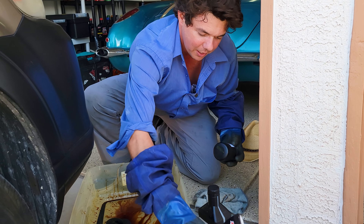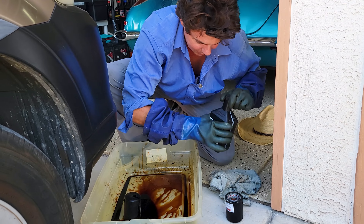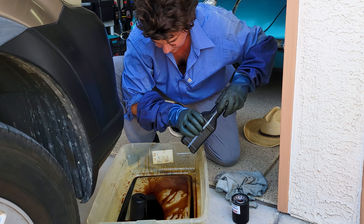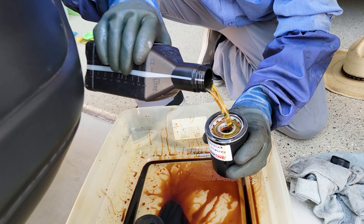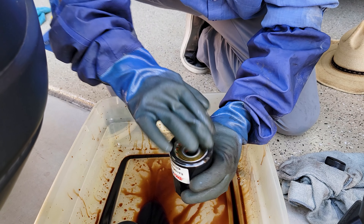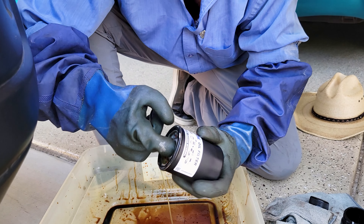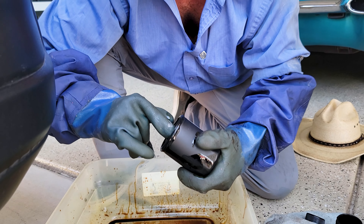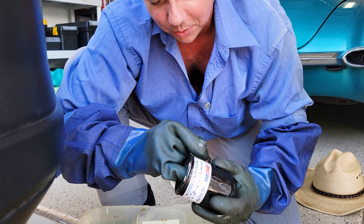The filter is good for 15,000 miles of city driving. Now we just top it off a little bit. It's on an angle, so we're going to fill it about three quarters. Lube up our O-ring, and now it's time to go ahead and rotate her, stick a finger in, and just twist it. And that gets it. It's better to put a pinky in because it spins better, and that goes all into the media.